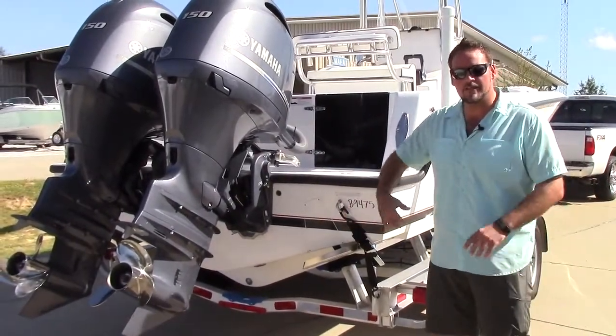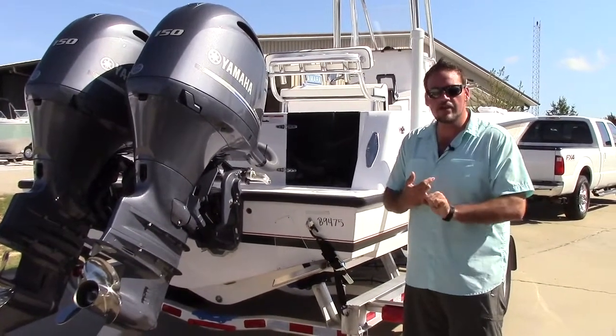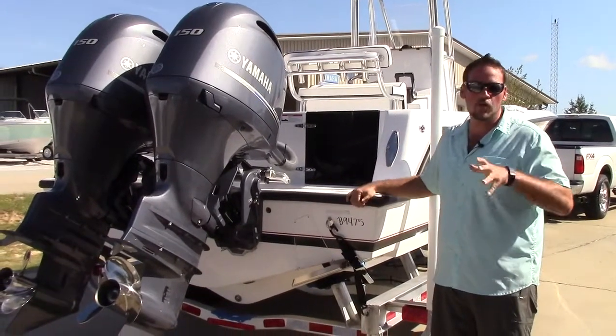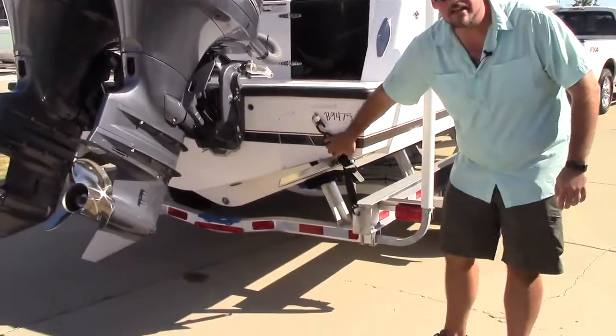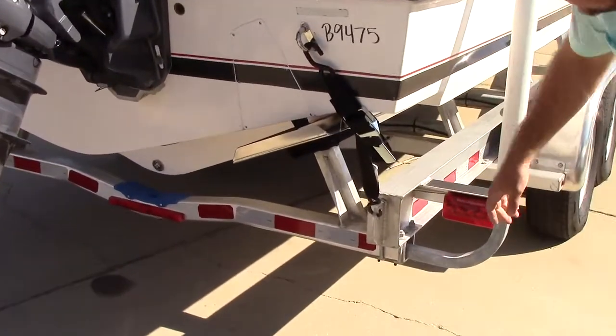You've done it on the back, you check to make sure that your brake lights are working, that your reflectors are nice and there's nothing peeling, no damage there. What you wanna do is, for long trips, and in Florida it's a state law, but it varies from state to state, so check with your state to make sure, there's rear tie downs here. It's just another line of defense to keeping your boat to your trailer here.